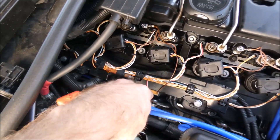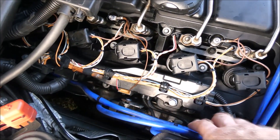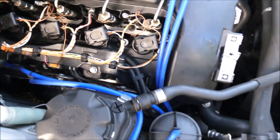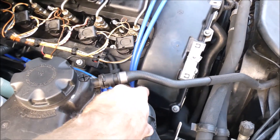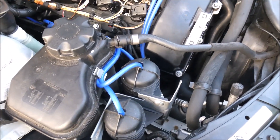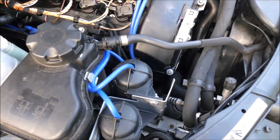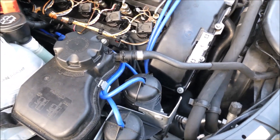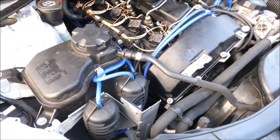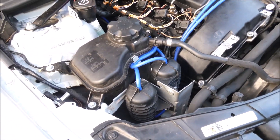Then you have one that connects the two T-junctions here together. On the other side you have the one going to the front turbo. To access it, I highly recommend having this unbolted — it makes it a lot easier. You can put your arm right in where that was and reach in underhanded for it. It's a lot harder to get that one on because your hand is in a very awkward position, unlike the rear turbo or any of the other vacuum lines.